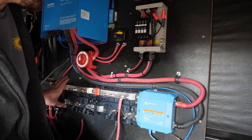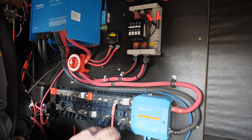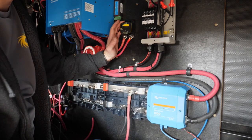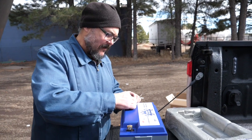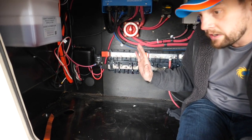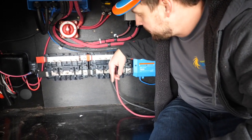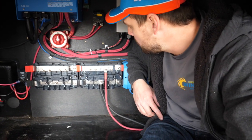With this new system, all the batteries are going to be tied into this bus bar. This takeoff goes to the 12-volt system for the RV, which powers the lights and other 12-volt appliances. This is essentially a disconnect and a breaker for the 12-volt circuit. We're prepping Robin's Battle Born batteries for installation in the bay. The entire RV's 12-volt system is integrated, the AC is integrated into the main electric panel, and the panel was pre-wired — the last thing is to grab the batteries and tie them in and start testing everything.